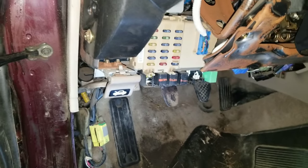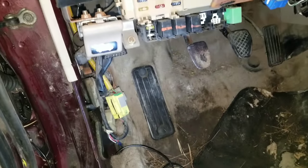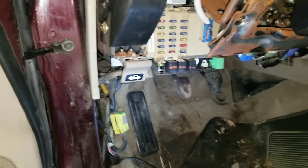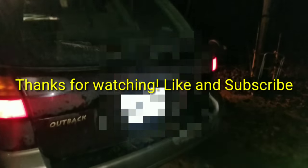Hopefully when I put the keys in the ignition and turn it on we'll have lights again — or it'll just burn out. Just burnt out the fuse again, so there's a short in the wiring somewhere obviously. Wait — there you go! License plate lights are working. Hard to tell because the flash is on in the camera, but yeah, quick fix.